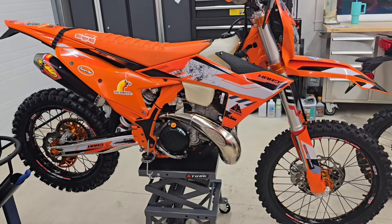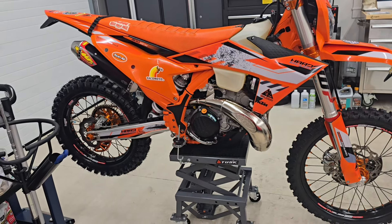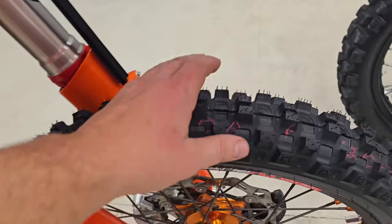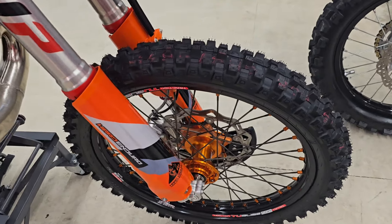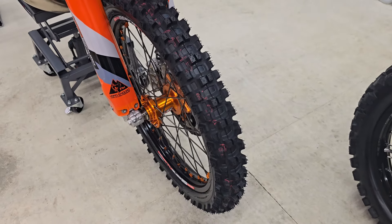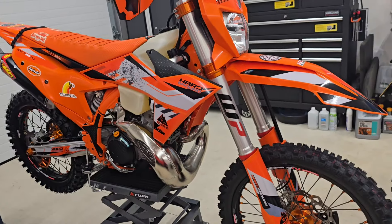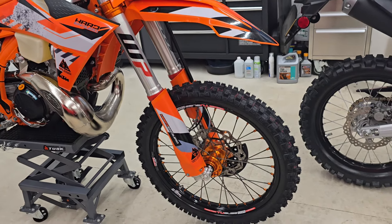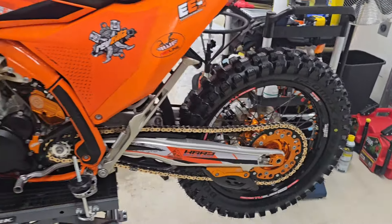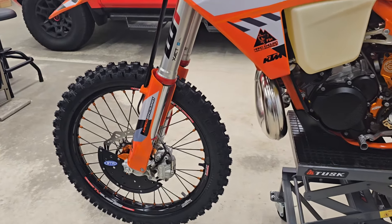Over to the KTM 300, which only sees trails and dirt — in the Pacific Northwest that means softer compounds for wet, slimy, slippery roots and mud most of the time. I'm running the Bridgestone X31 on the front in a 90/90-21. I like the narrow tire because it knifes into soft terrain and finds traction; fatties tend to float when it's soft. This is a two-stroke so it's light in the front anyway. I'm running tubeless on the rear; on the front I'll probably go tubeless next tire change, though at 12 psi the main advantage is trailside repair.